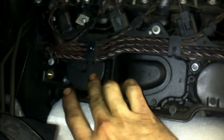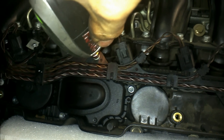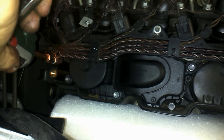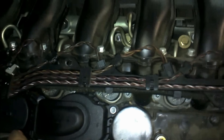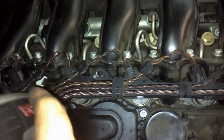This is the PCV for this diesel engine. It's got four Allen key screws as well, but firstly you've got to take off the wiring for the solenoid injectors — these are little Torx bits; I can't remember the size, you might just have to check that yourself. I've been told you're supposed to do these PCVs at every major service, so keep that in mind. If you want to keep your E53 seals intact, do this every time you do the air filter or every second time. Once the wiring is out of the road, start undoing the Allen keys — they're not on too tight.